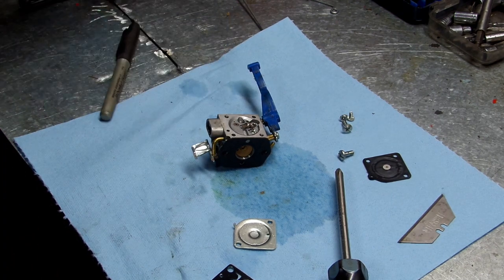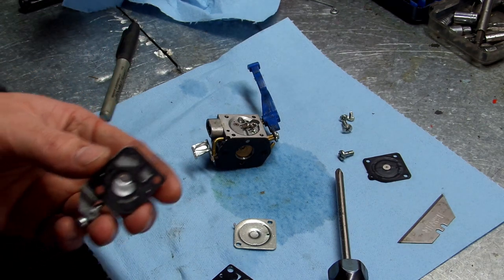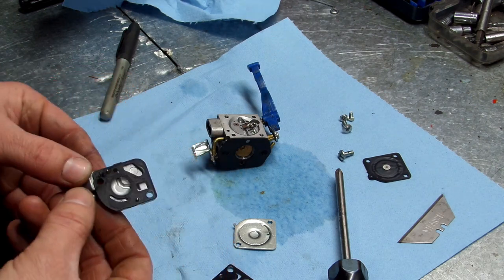But from what he was telling me, I figured he's having a gas issue, and then when I dumped that tank out and the fuel filter came out, I knew that it was clogging up on the screen on the inside cover. Okay.